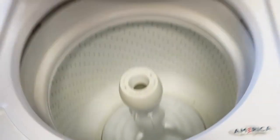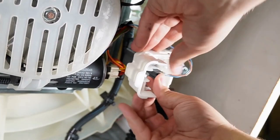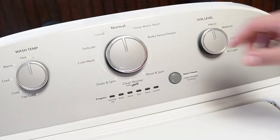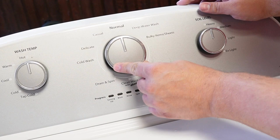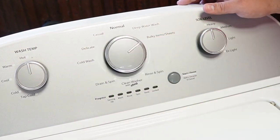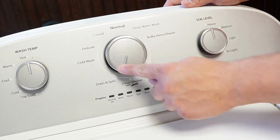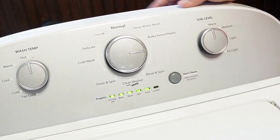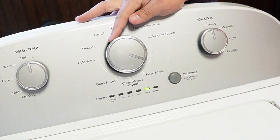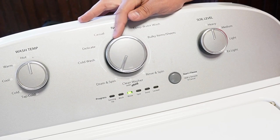Now that we've done the first reset, let's attempt to recalibrate this washing machine through the calibration mode. This is a must-do if you've installed any new parts, from a board to a balancing rod. With the washing machine freshly rebooted, rotate the dial again counterclockwise 360 degrees. Then turn the knob right three clicks, left once, then right once again — it should be pointing at 3 o'clock or all the way to the right position. You need to do all these things within three seconds, and it may take a few attempts, but if done right, all the lights at the bottom of the washing machine control should flash on and off, showing that you've entered diagnostic mode. Once you're in this mode, turn the knob clockwise four times. The rinse light should be the only one illuminated solidly by itself — this is the recalibration mode.